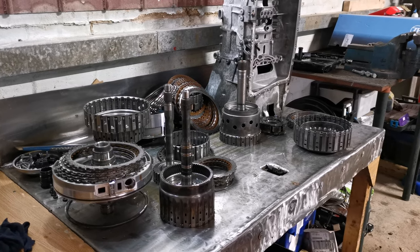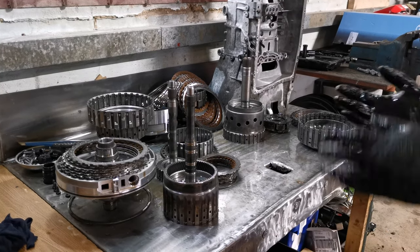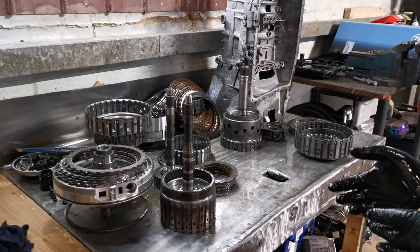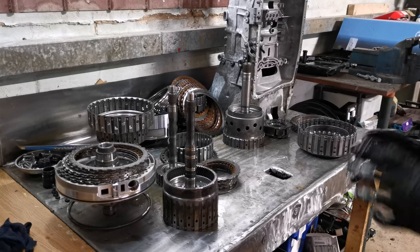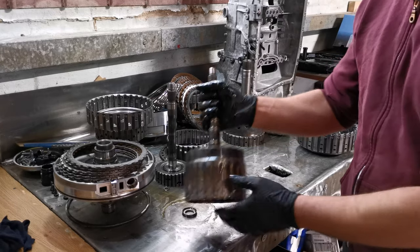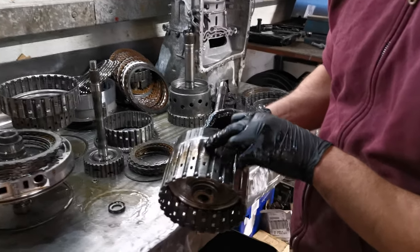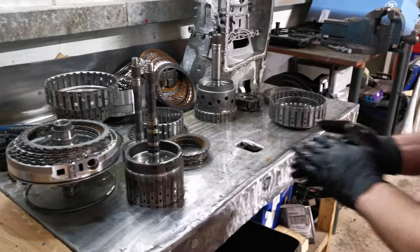You can get a 4F85, which is specifically targeted at the E-clutch, or you can get a 4F8A, which is also to do with the E-clutch, but also normally tends to crop up when it's more of a fluid pressure issue inside a clutch drum or something, rather than a burnt out clutch. So 4F85 can come up for that reason, or it can come up for the clutch actually being burnt out and just generally slipping. I've seen them to the point where they're burnt down to the metal and there's nothing left. You get a lot of heat build up on the drum and it starts to warp the drum, and you just end up replacing the lot. So I mean, this has had a very minor bit of heat, you can see the rainbow effect, but there's nothing to be concerned with at all on that.